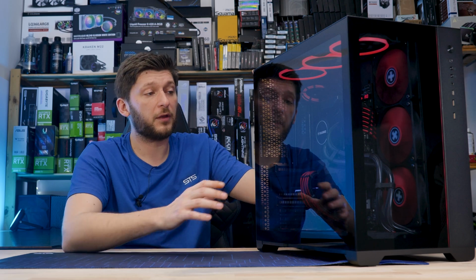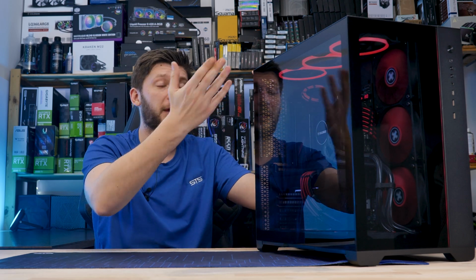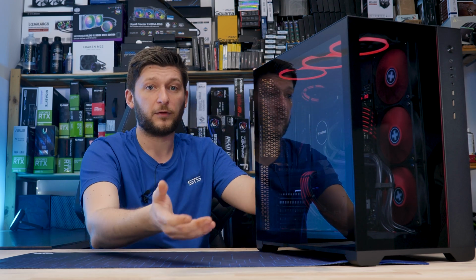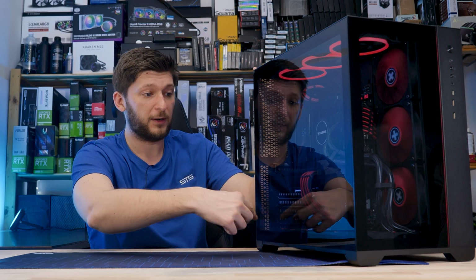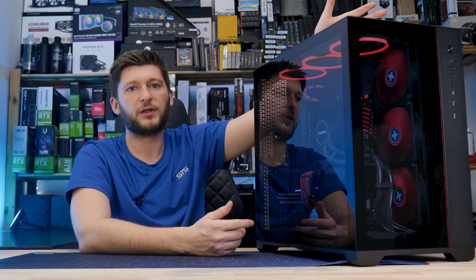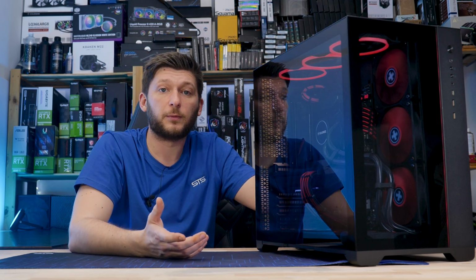If you go water, the fan layout is actually really simple. Bottom intake, top exhaust, that's rather easy. And then the fans on the side are either pumping out the cold air coming from the bottom, which becomes hot air thanks to the radiator, and then out, or it is pumping cold air in through the radiator. Which one is better doesn't really matter at this point.